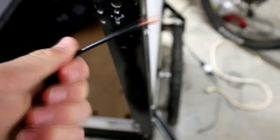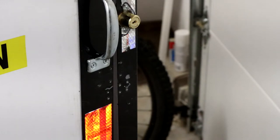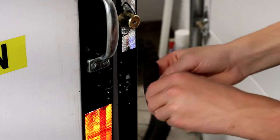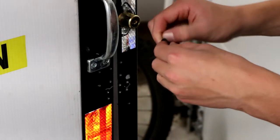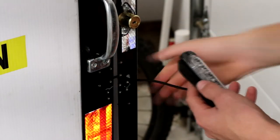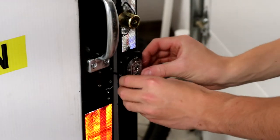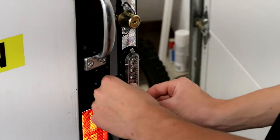I have all the main holes drilled, but as you can see there are these other two holes which also need to be drilled, so I'm going to drill those smaller holes on all 6 of these now. Now I have all my holes drilled, and I'm going to show you the process of installing each one. First we have this foam gasket that will go in the back to help with any water getting into it, or it will probably help with the vibrations a little bit. Once we have that going over, we can put the cord of the light through it and also through the hole in the frame of the trailer. Then we take our machine screws, poke them through the hole and through the trailer, and then put the nut on the other side and tighten the screw.